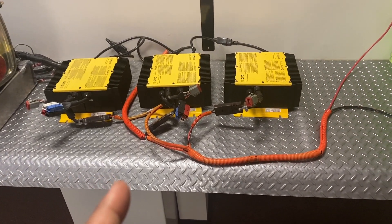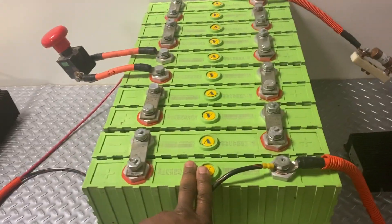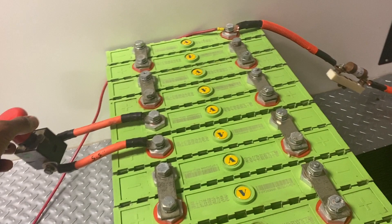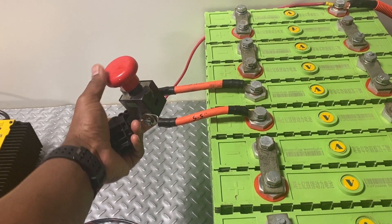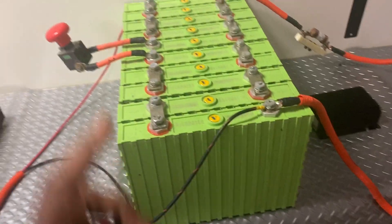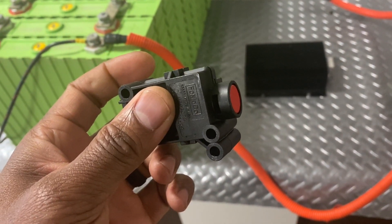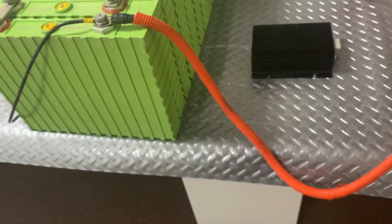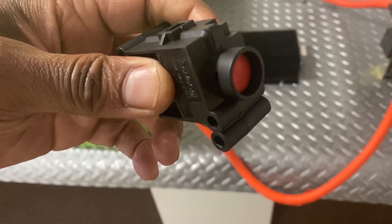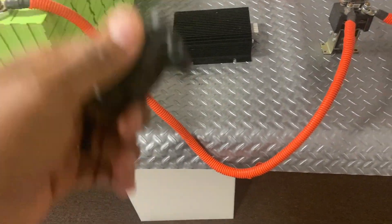Your onboard charging system is connected to your battery pack via these two wires. This is a representation of what goes in your vehicle — there are about 36 of these, which will get you a range of about 100 miles. This here is an emergency cutoff switch that interrupts power between your battery pack in an emergency to shut the voltage off. This is called an inertia switch — it disengages energy in the event of an accident or a sudden violent vehicle movement. As you see, it's pushed in to engage; in the event of a violent move, it pops out and disengages the power.